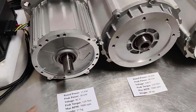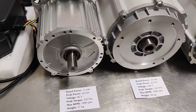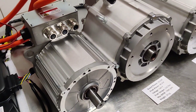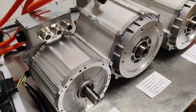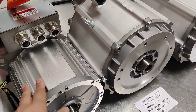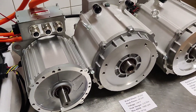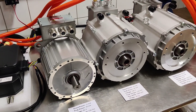These are small motors but with high power: 30 kW peak power, 150 Nm of torque, 7000 rpm, and 26.5 kg. This is an extremely powerful small motor for these small vehicles. With the Fiat 500 it runs locked in 4th gear and starts and accelerates very fast — more than sufficient for the Fiat 500 and also for the Fiat 600.